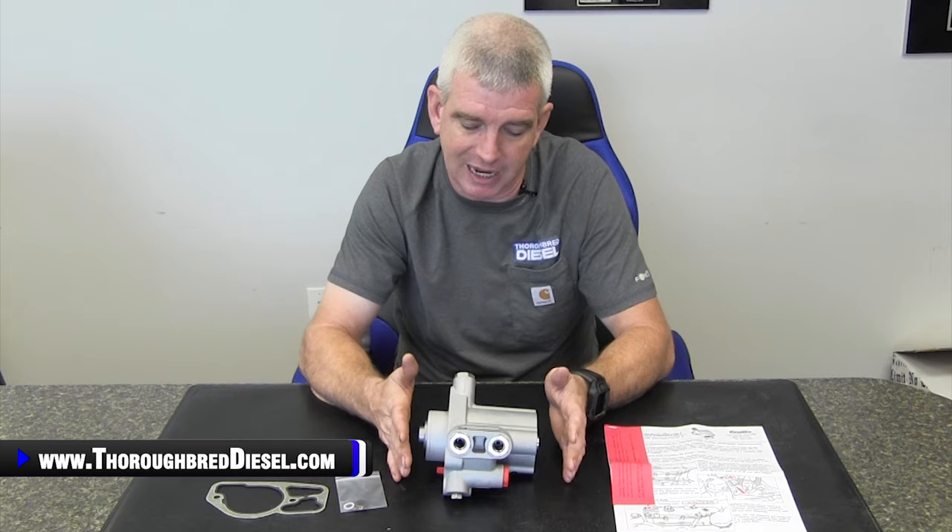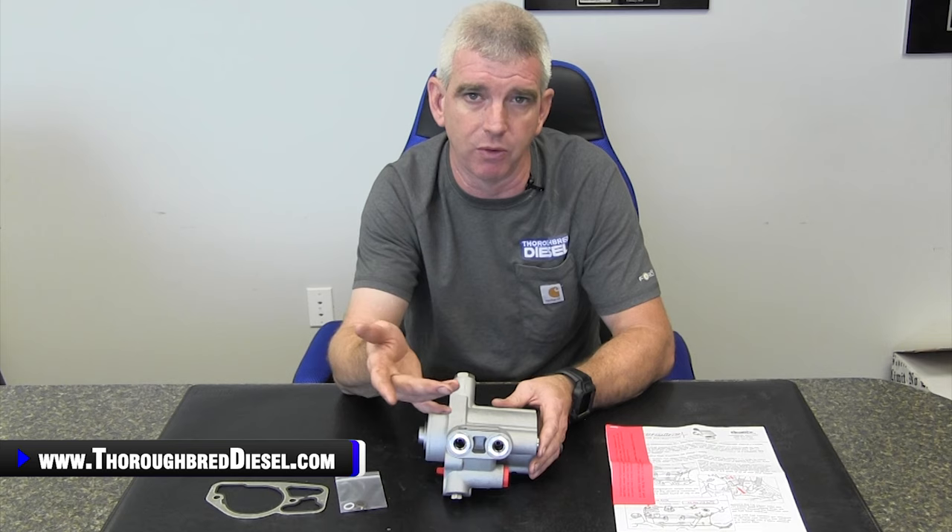On the performance side, this pump is designed to flow more oil — not make higher pressure. It's going to be able to flow more oil. With correct tuning, as long as your tuners are not commanding anything more than between 2,800 to 3,200 PSI, this pump is going to be able to flow the correct amount of oil for what the tune is calling for — what the truck is demanding as it's loaded.